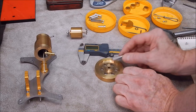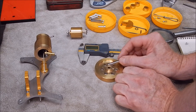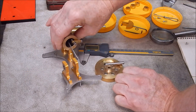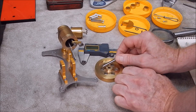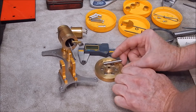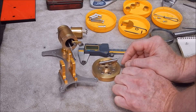The original thought was to machine it out, bush it, and Loctite in a sleeve, then re-bore it. But thinking about it — they had the shaft in the flywheel with little shims to space it out between the two bearing supports. What I've decided to do is machine this out uniform and then make up a new flywheel pin. A little bit of lateral thinking — we'll make a stepped flywheel pin, retaining the same end diameter but increasing the centre section, the same as they do on Ducati motorbike crankshafts. So that's basically what I'll machine up.